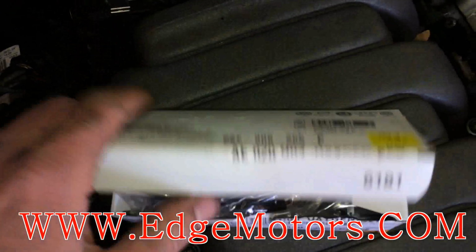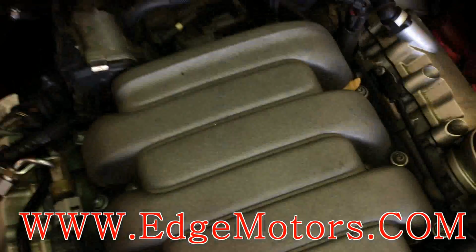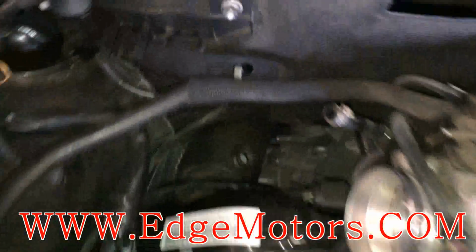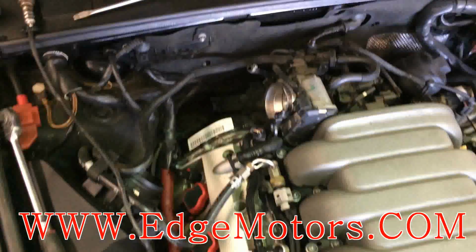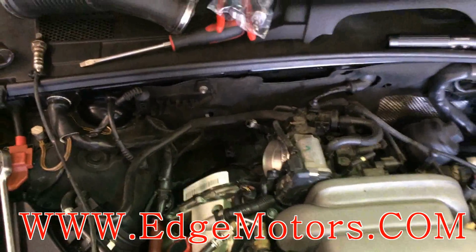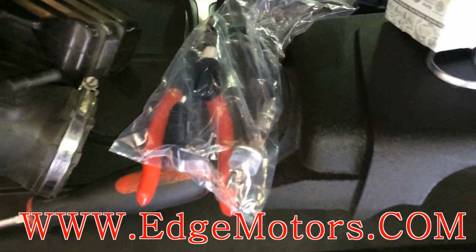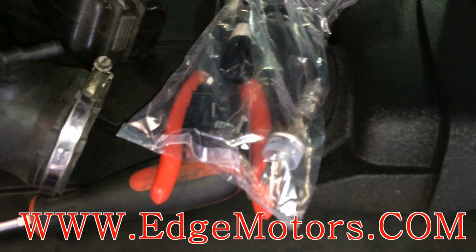Here you go, we got our new oxygen sensor. I would suggest using only dealer parts, special oxygen sensors. We had problems with the aftermarket sensors. We even had a problem one time where we bought 4 oxygen sensors, and out of the box all 4 weren't working properly, and they were misleading us in different directions. So use only OEM oxygen sensors. Do not waste your time on aftermarket sensors. Although the OEM ones are much more expensive, it might save you a lot of time and headache.